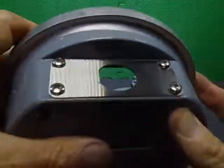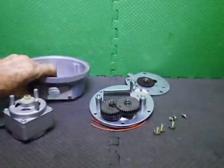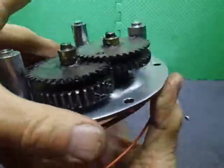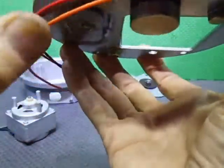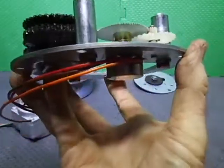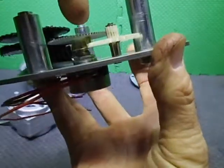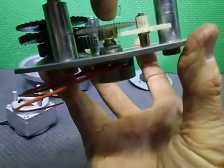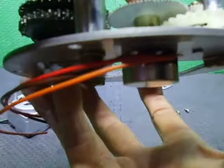These are actually not too bad at retaining grease at the bottom and I can always add a little bit to the side through the grub screw. The socket mount for the chassis is in position, has been siliconed and screwed in place. I've assembled the gears, spaced up nicely, and put on the new potentiometer. With the short shaft potentiometers you've got to run the pot gear up the other way and set it up so the grub screw doesn't hit the gear.